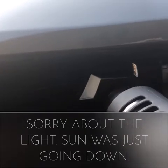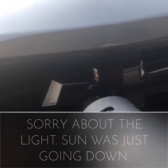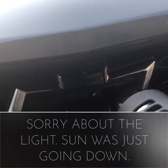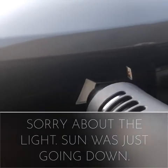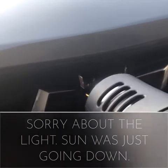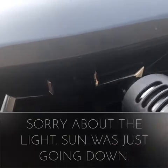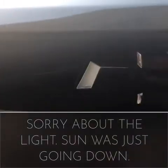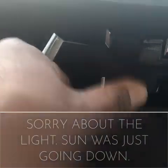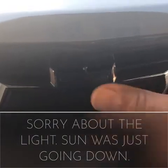You just go over it a little bit and you'll start to see it take form and take shape from the symbol itself. If you start seeing it do that, you're in good shape — it's shrinking on and sticking on. Make sure you get around all the edges real good. When you trim it, you'll be able to remove the excess. If you see air bubbles, stop and peel it back. It is a little hot, but you can still try to flatten it with your finger briefly. See how much better it looks?